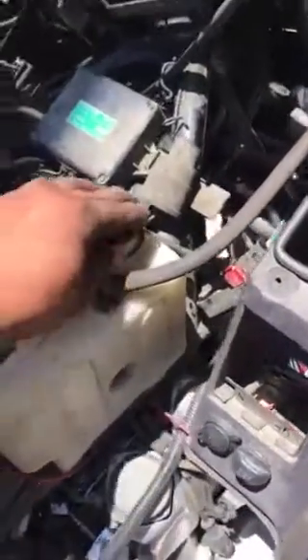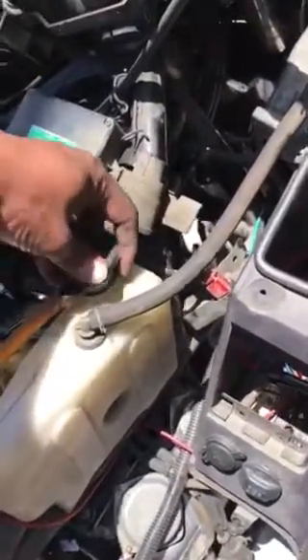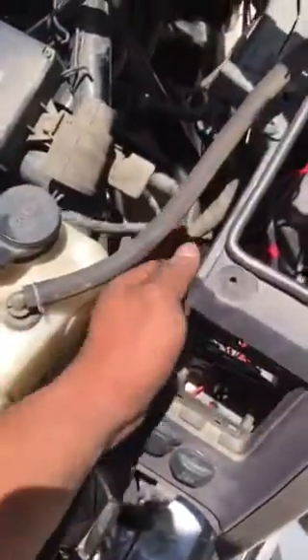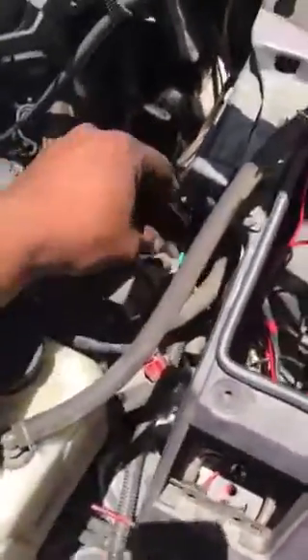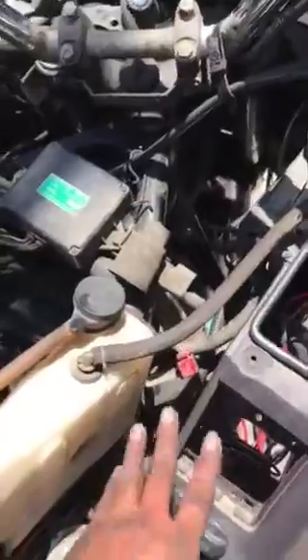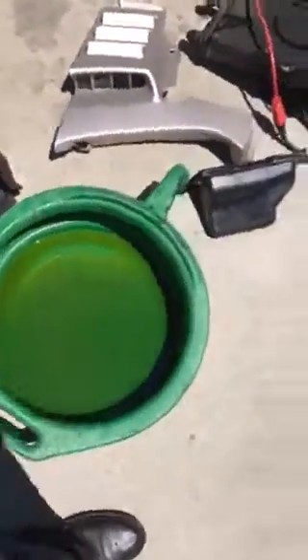While you're doing this, you can flush your radiator fluid, because you're going to be in it. The radiator cap goes up here. This needs to be removed to get to this. It's freaking hard to get to the choke cable. You'll have to remove the radiator — have a bowl to catch the radiator fluid.